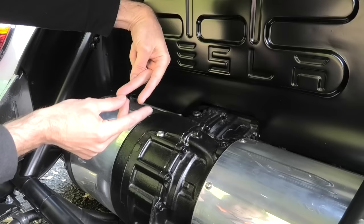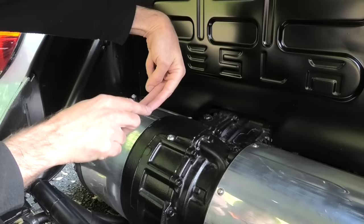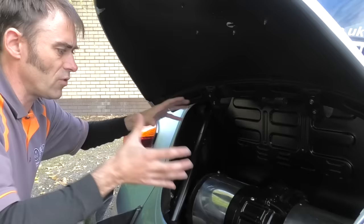These triangulations go up into a very strong place in the body, and the frame rails coming out underneath in the floor pan have been strengthened and triangulated as well. Basically there are two frame horns coming out, and in old Beetles during drag racing they'd want to twist. We've triangulated those two frame horns so there's no way they can flex now. The whole back end is locked in place. The motor is still rubber-mounted — not hard-mounted — giving us the best chance of the rear end not getting ripped apart.